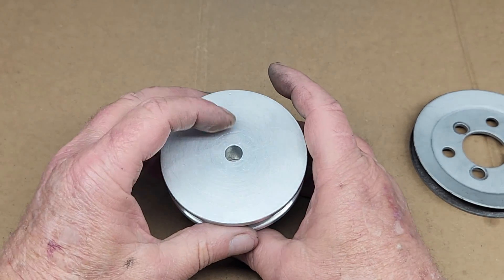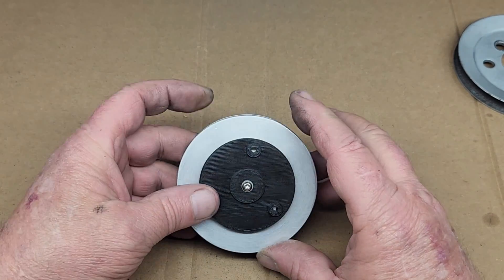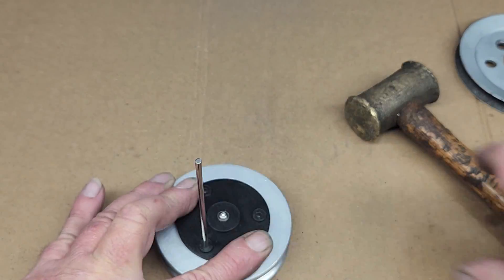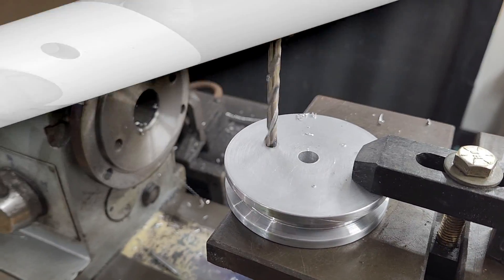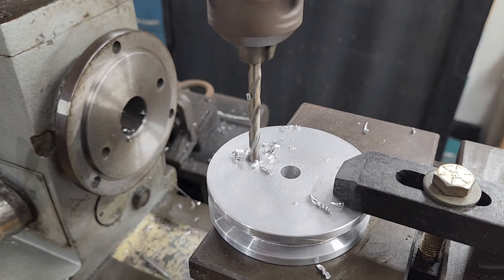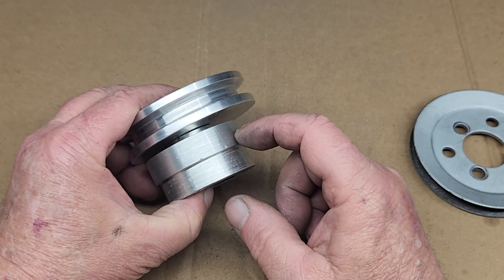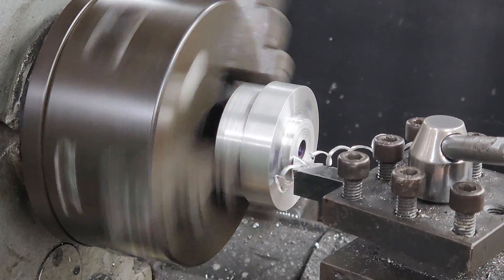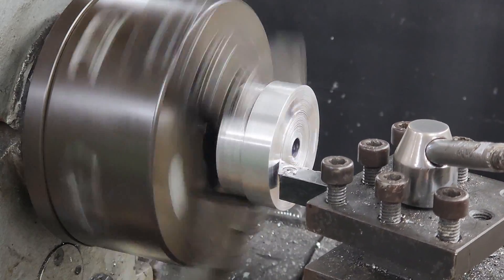Let's start with drilling the new holes. A few episodes ago we made a 3D printed template to help us figure out exactly where to drill the holes on a few parts. We're going to be cheating once again and use this to mark the locations of the holes on the new pulley. And there we go — let's drill these out. Off camera I did use a center drill to establish a pilot hole, and now I'm finishing off the hole with a larger bit. I'll finish the other two holes off camera. Now we need to trim some material off this pulley adapter. In order to ensure a perfect belt alignment, I trimmed this adapter to the approximate size and then test fit it on the car. After that, I was able to finish trimming the part for a perfect fit.